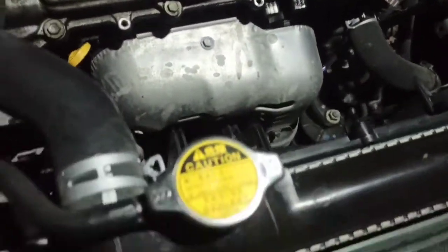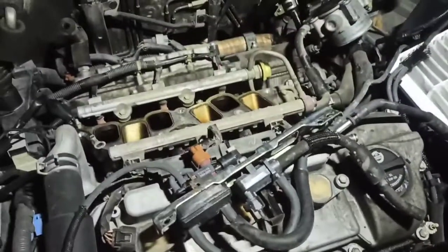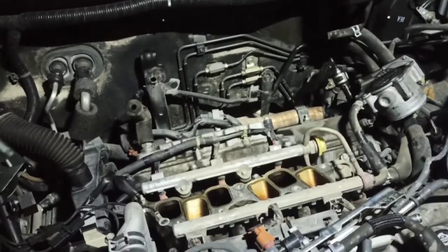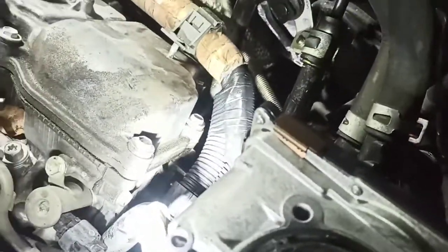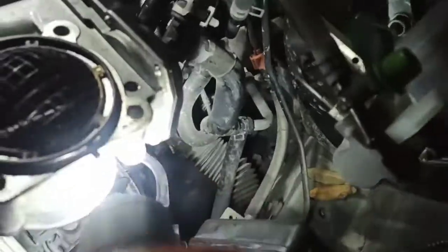Toyota — I don't know what they were thinking. The engine could have been positioned a little more forward to give more room in the back. Let me go ahead and unplug the O2 sensors and release the power steering hose line. Now for the last task tonight, I want to release the wire harness all the way around on this side — once you do, you get much more slack, which is definitely worth the effort. There's a camshaft sensor connector with wiring that's a pain to get to; I used hose removal pliers.